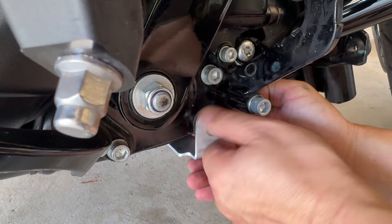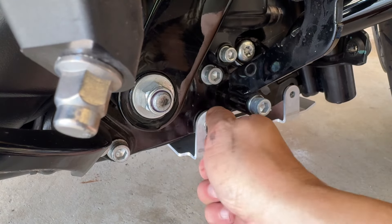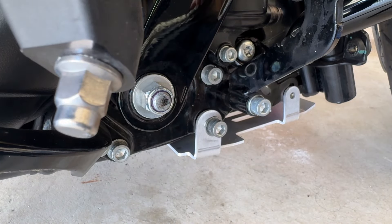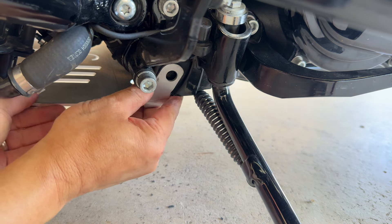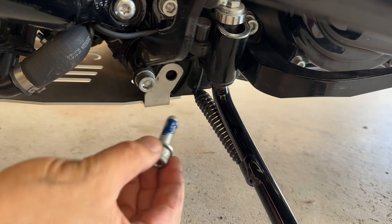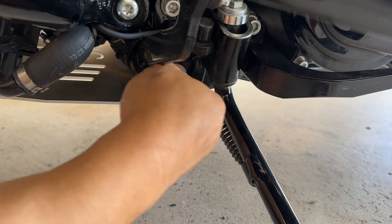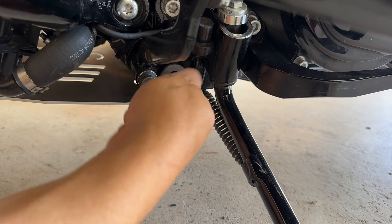Just get that started by hand. As an aside, you always want to start bolts by hand first and not use a tool — that way you make sure you don't cross-thread parts. Got that indexed and it's spinning freely. I'll go to the other side and do the same thing. Let me get a good angle on this one, make sure it's lined up properly. I'll put some more blue Loctite on there, thread that in by hand again just to get it started and ensure I'm not cross-threading. That'll also help index the part so it doesn't fall off.